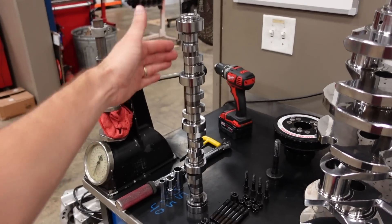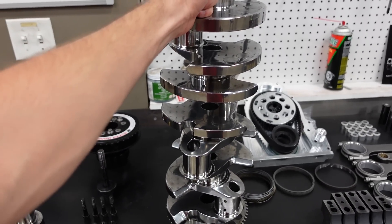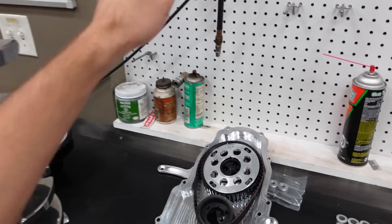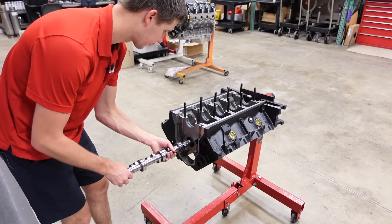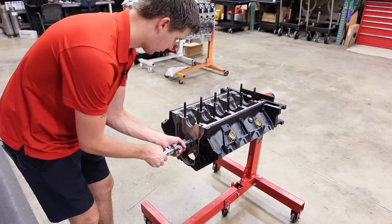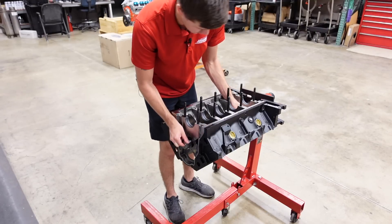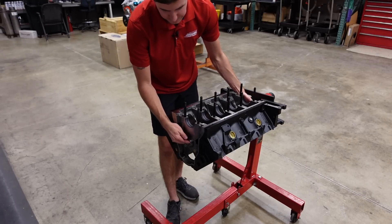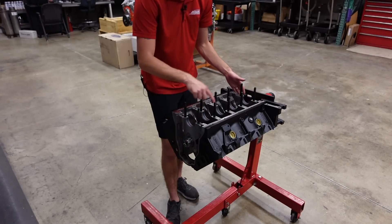In today's video we're going to start with the camshaft, get it installed on the block, and make sure all the cam bearings are straight and smooth. Then I'm going to drop the crankshaft in to check our thrust bearing clearance — the fore and aft clearance of the crankshaft in the block. I always like to install camshafts into engine blocks totally dry because it gives you a good sense of how straight the cam bearings are without any of the stickiness or resistance from the sticky assembly lube. We'll bring this guy in carefully not to nick the cam bearings, and once installed we give it a wiggle back and forth — it should just glide super smooth. Then I'll push it forward just a little bit and apply lubricant on all of the journals of the camshaft.